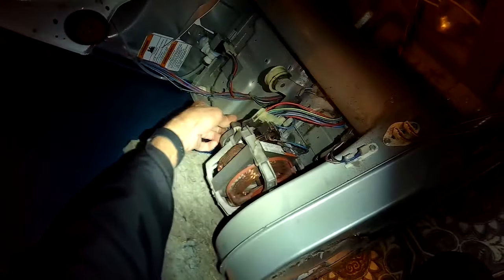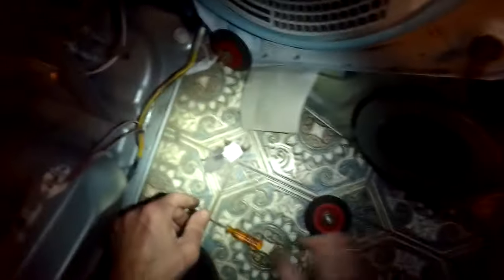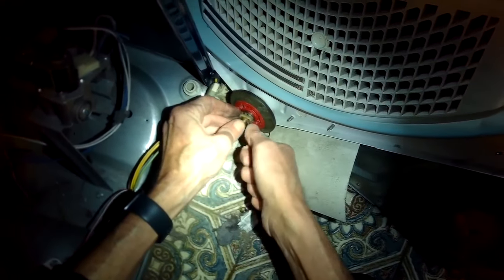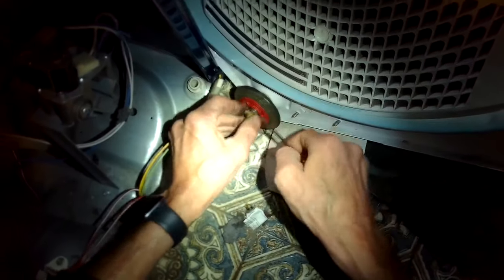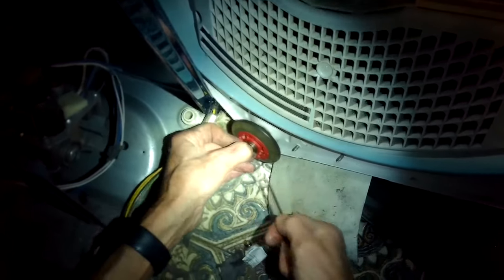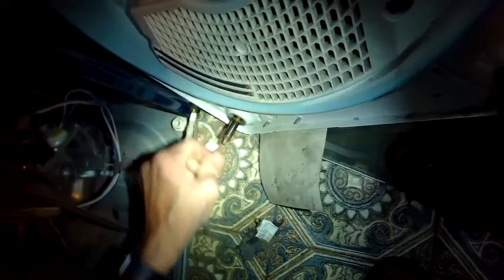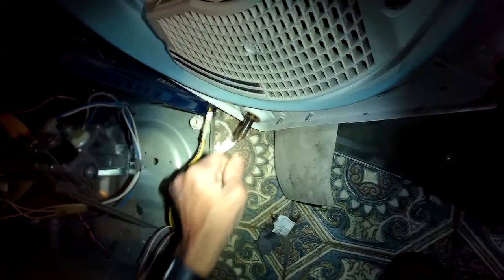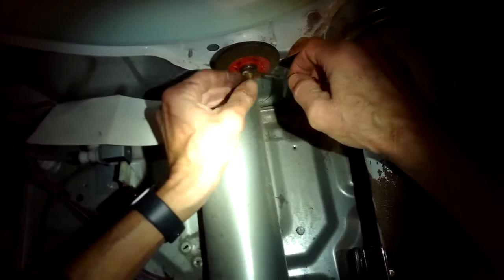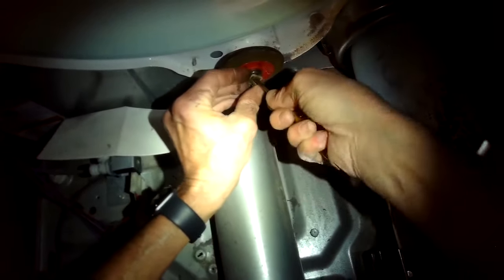The support rollers don't need any lubricant — you just put the new wheels on. I'm going to pry off this one on the other roller. The ones that really squeak from a roller are if it feels kind of wobbly, like if it's wearing out — that's probably going to cause a squeak. Sometimes you have to replace the shaft itself, but usually they're okay. It's more often the wheel itself, where part of its bearing surface gets worn out.